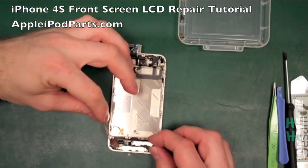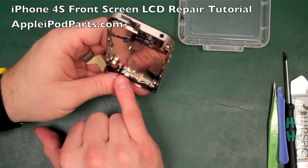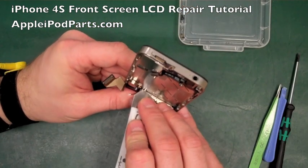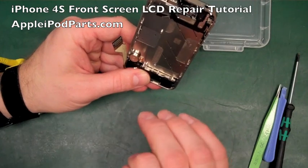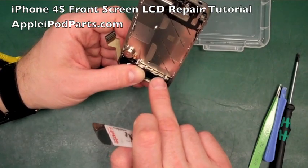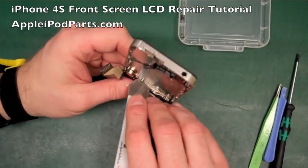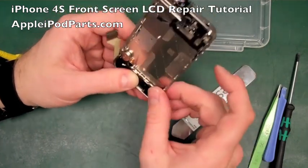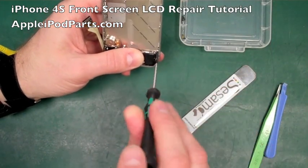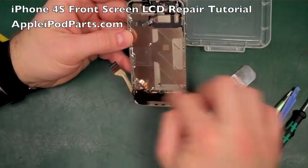Next thing we need to do is put the speaker dock in. That sits in bottom first, in there, and then sits down, and what you'll find is there's four little tangs, for want of a better word, in there, and it's just a case of using the spudger. They click in, you push them in, and they go in that gap there and kind of spring out. They're like spring clips. If you force this down now, it might not go down fully and it won't sit properly, or it will just bend those tangs and ping them off. Now they are like your aerial connection to the chassis of your phone, your frame, and you need those. So make sure they're all pushed in nicely, with your thumb keeping pressure on that, because it will spring back out. We're just going to put that corner screw in, just to try and prevent it from springing back out. Put that little corner screw in, and there we go. There's the speaker.